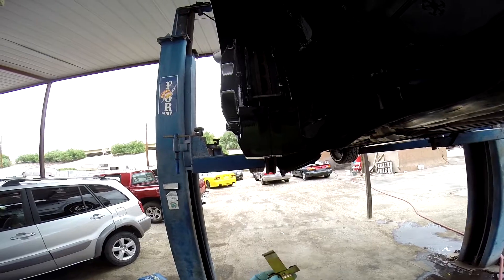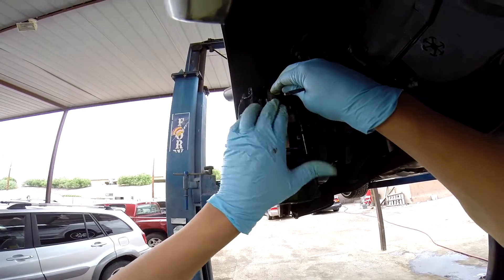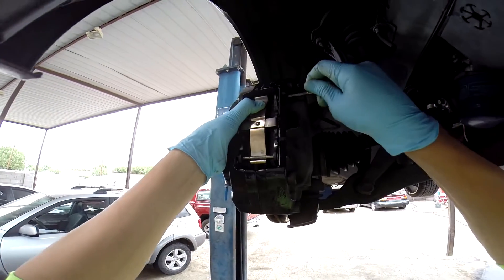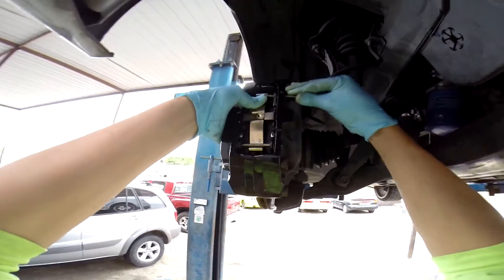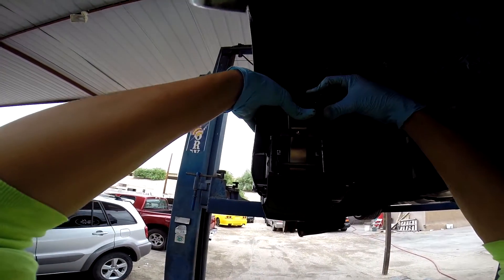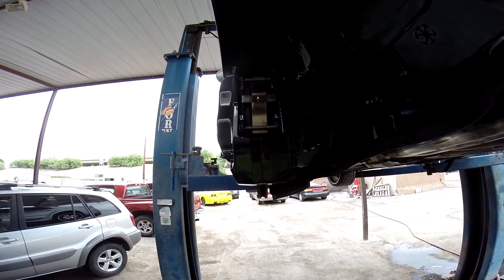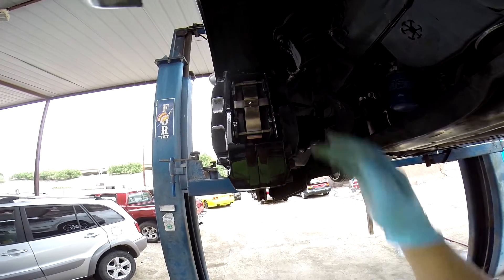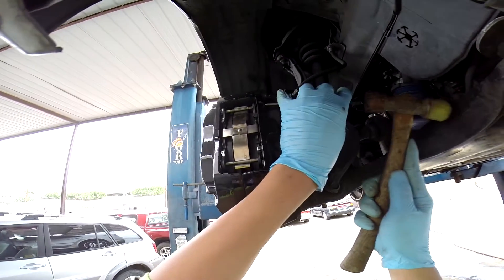Let's put the next one on. Now we're going to put this little bracket in there — we're going to have to pressure it down and put the top pin in. Just want to make sure you make it go to the top of it. Going in fairly easy. Let's go ahead and hammer it in. Make sure you get it perfectly into place, directly in the center. On these Brembos, you can actually push the back of the pin in as far as it can go.